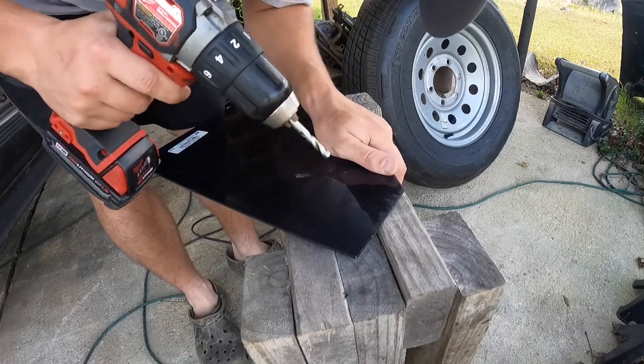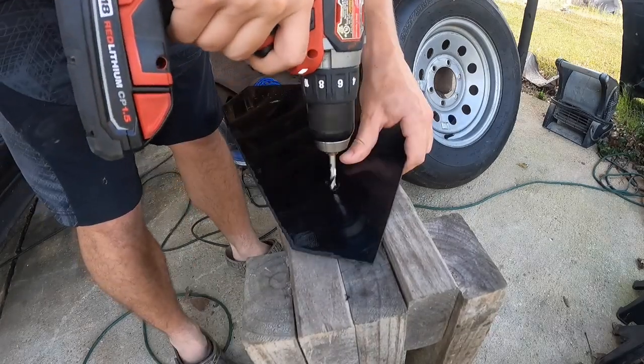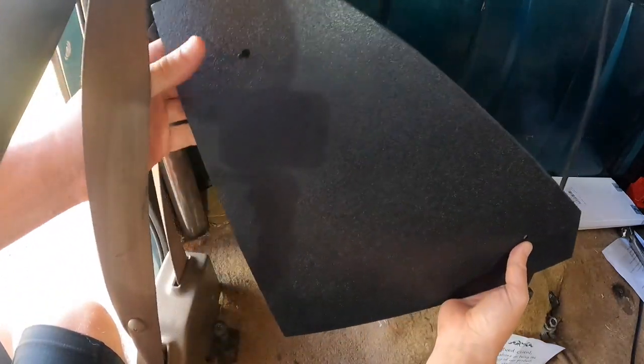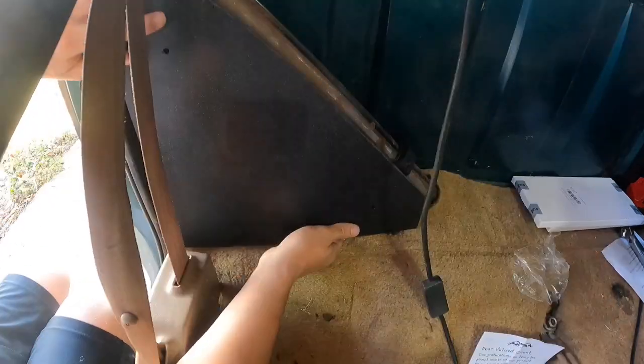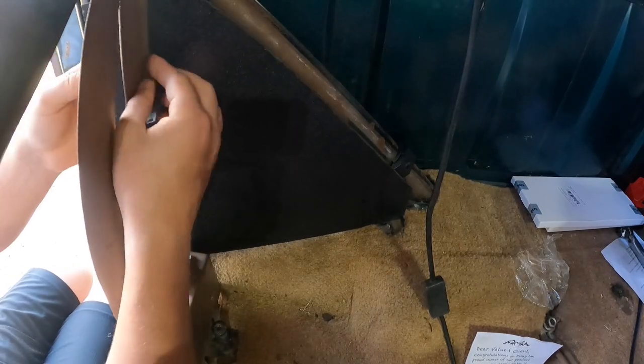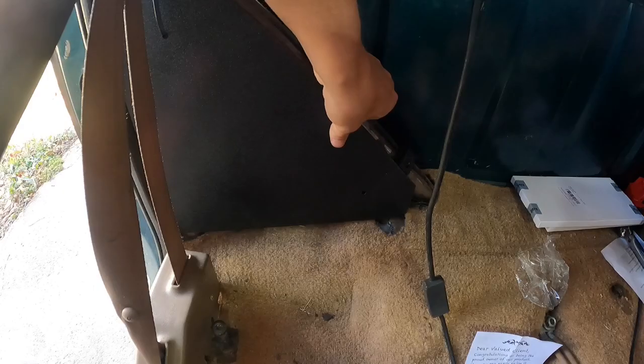Using my best approximation I've determined where I think the bolt holes need to go, so we're going to find out. What we're hoping for is that this old hole and this old hole line up with that old hole and that old hole. We'll stick a lightweight race fastener through here — just for now, not permanent. You should never use lightweight race fasteners for permanent installation. Let's see if we got this other one — hey, look at that, we're in the green light. You can see through the other side — we hit it right on the mark.